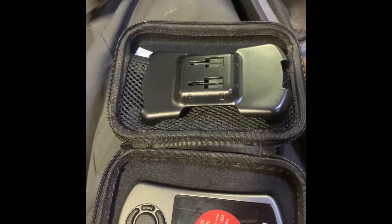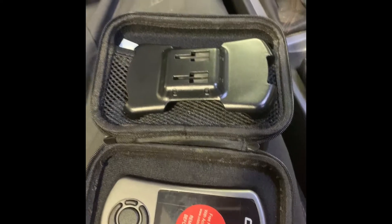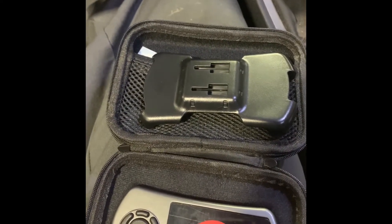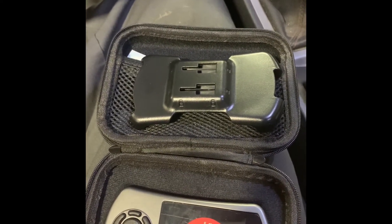The instructions say you want a battery charger on it because if you don't have one and your battery is low, you can mess your car up — especially if during the flashing process the battery dies. If that happens, you can mess the ECU up and the car won't start. So for safety, put a battery charger on there to keep the battery charged while you're doing this.